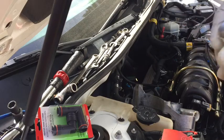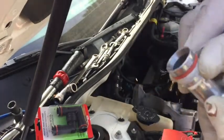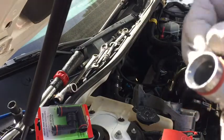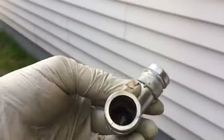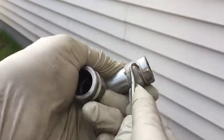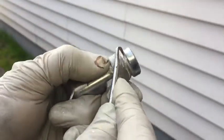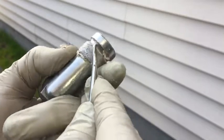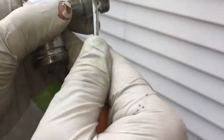Looks like I'll have a lot of cleaning to do. All of this is hardened on there, but it looks like they just used a silicone grease to get them in there. So I'm gonna go ahead and clean these up and replace. When you go to clean these after you have them removed, use maybe a screwdriver or something. Don't dig into the metal. You don't want to score it or scar it or anything. But get these edges in there if there's anything in there.